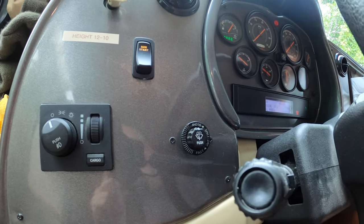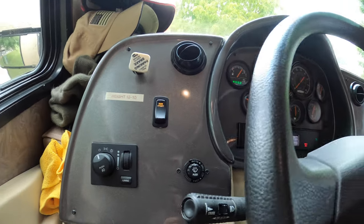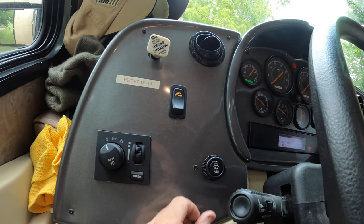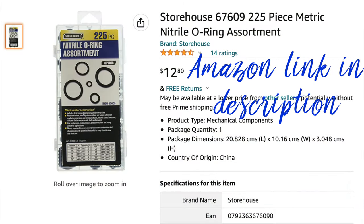How do I get this little knob that Tiffin and Freightliner put in to work my wipers? The secret to that is very simple — one little 20-cent o-ring. You just push this o-ring right over the top of the knob, and looky there: easy to turn on, easy to turn off. Especially if you're a little bit older and your hands might be a little arthritic, it makes life a lot easier than trying to grab that knob driving down the road at 65 miles an hour. I'll put a link in the description for the o-rings I purchased — I got them at Harbor Freight. It's simple and it costs practically nothing.